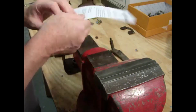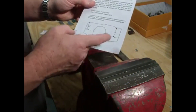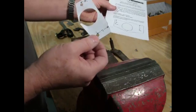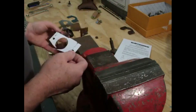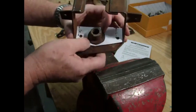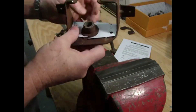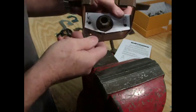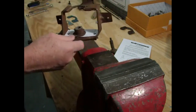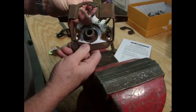We have a template that comes with the kit. The idea is to cut this out for placement of the new neutral safety backup light switch, as I've done here. We're going to fit it over the inside of the new one, line it up at the top, center it, and this will provide the location for the holes.